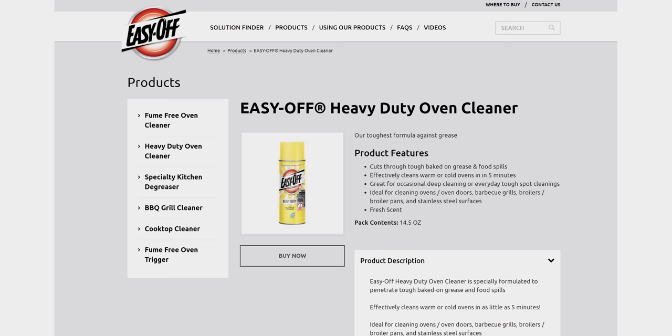Instead of hard sanding, we opted to use a soft wire wheel to both rough the surface and get rid of any excess oxidation from the cleaner. It was a long process, but for any good paint job it's like 80% prep, 20% painting. After that it was just a wipe down with isopropyl alcohol, then time for priming. With all the pieces laid out, it was sprayed a couple of times lightly, then got a heavier finishing coat — being careful not to get any runs. Those will show through to your final product unless you let it completely dry, sand it down, and then re-coat it. Unfortunately we just used a regular flat black enamel from Home Depot. It's not the best, but the case actually got painted instead of waiting forever for the person who was supposed to do it professionally.